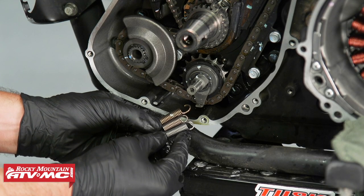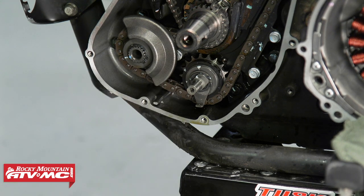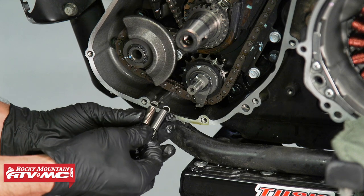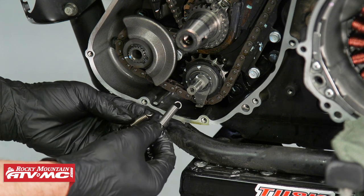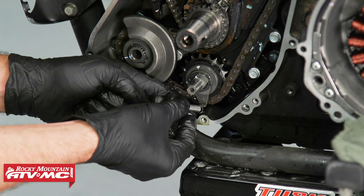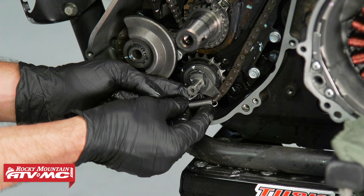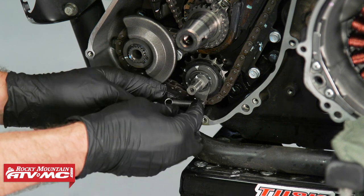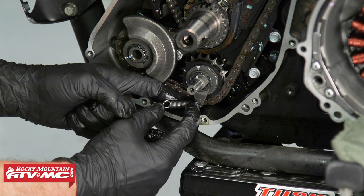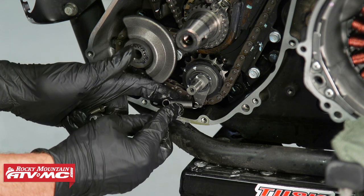These two smaller springs, these are the ones that come with the Doohickey. So let me get that out of our way, the stock one. Now, Eagle Manufacturing recommends installing this longer spring first, or checking it first for the right fitment. And there's no exact number for this, but you want about 8 to 10 millimeters of stretch before it hooks onto this post right here.